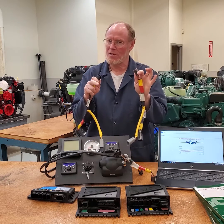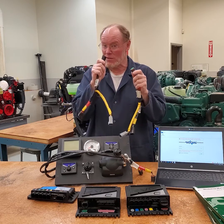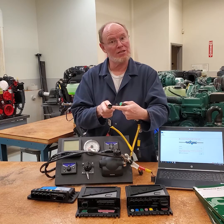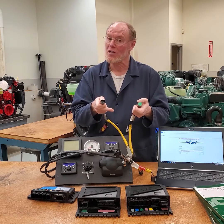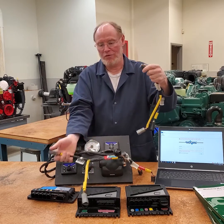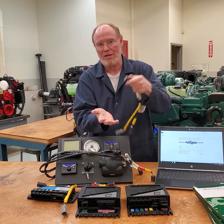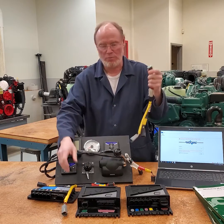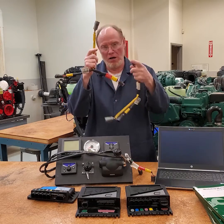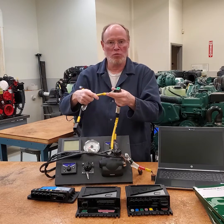Make sure you write that down, because you might be looking at multiple plug connections under the dash. Second thing to do: flashlight. Look in there with a flashlight, look at the pins, make sure it's not gray, green, or blue — you don't want corrosion there. The other thing: take the connector, tap it against your hand. If any water beads — there's water in there, that's your problem. I always check connections for water if they're in an under-dashboard loop hanging. Sometimes you can see it, but it'll bead up on your hand.